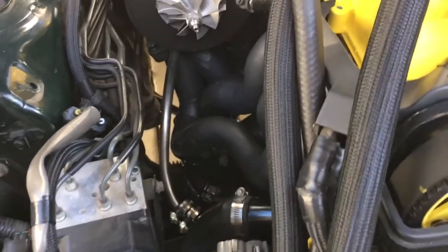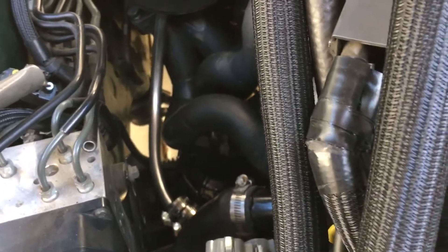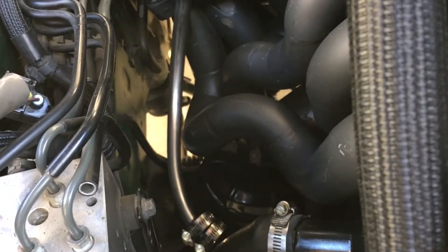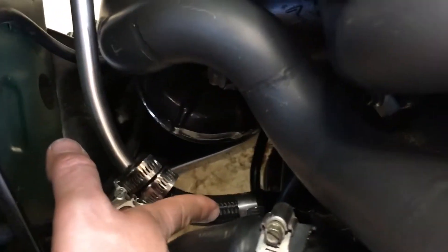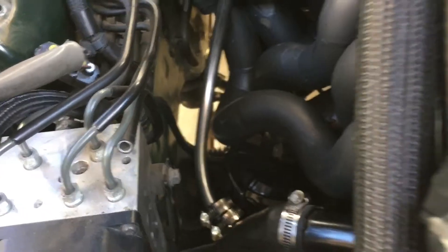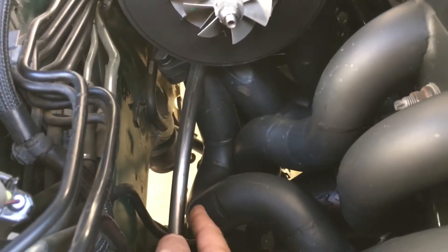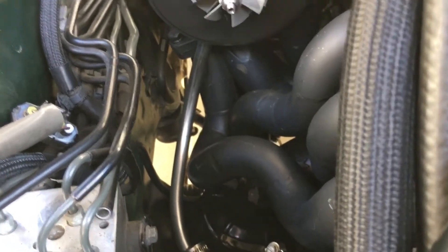After still having oil coming from the turbo, we determined that the drain line was originally too long and not angled correctly. So we went ahead and did a hard line — a stainless thin-tube hard line, still a dash-10 fitting. We flared the pipe so it would be straight onto the fitting, with a nice downward angle, and then used a bit of dash-10 rubber braided hose for flex going into the block, which has a 45-degree angle. Everything's at a downward slope now. If it keeps leaking, at least this is now a hard line, so I won't have to worry about burning through hoses from the manifold heat.